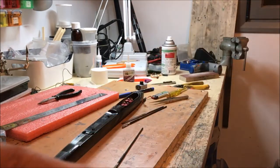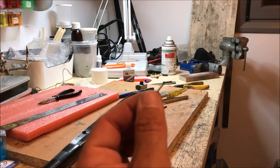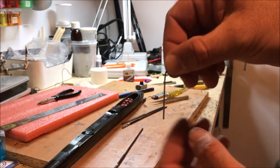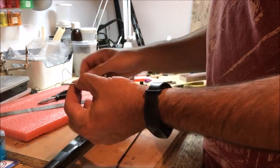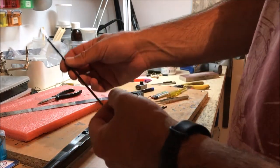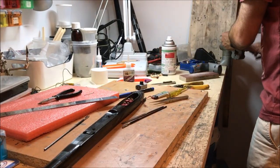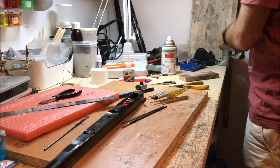And then what I have here is about 1.5 to 2 millimeters long on this side, and this one is about 45 millimeters long on the other side. And again, this length is a question of how much you've trimmed your push rods. Now I'm going to put it back into the vise, and on the last 15 millimeters I'm going to make some slots.